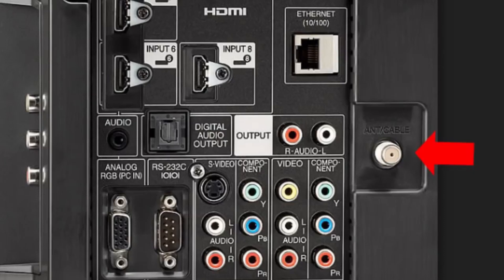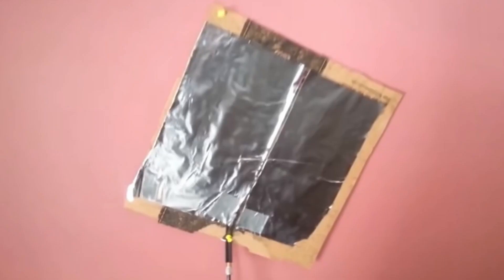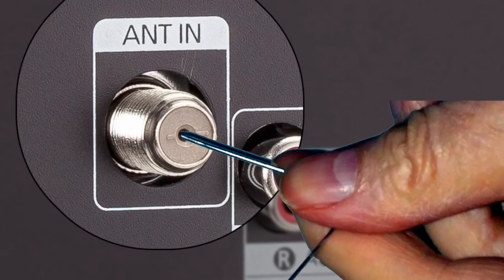Attach the coax to the connection and set the antenna nearby. You can use an old rabbit ears antenna or you can make one out of aluminum foil. There is a link in the description to a video that will show you how to make your own antenna in five minutes for less than five dollars. For test purposes you can even get by with a large paper clip in your finger. Just insert the paper clip into the antenna connection and hold on to it while you run the channel search. It might be a little awkward to hold on to the paper clip and operate the remote to scan channels, depending on where the antenna connection is located on the back of the TV.